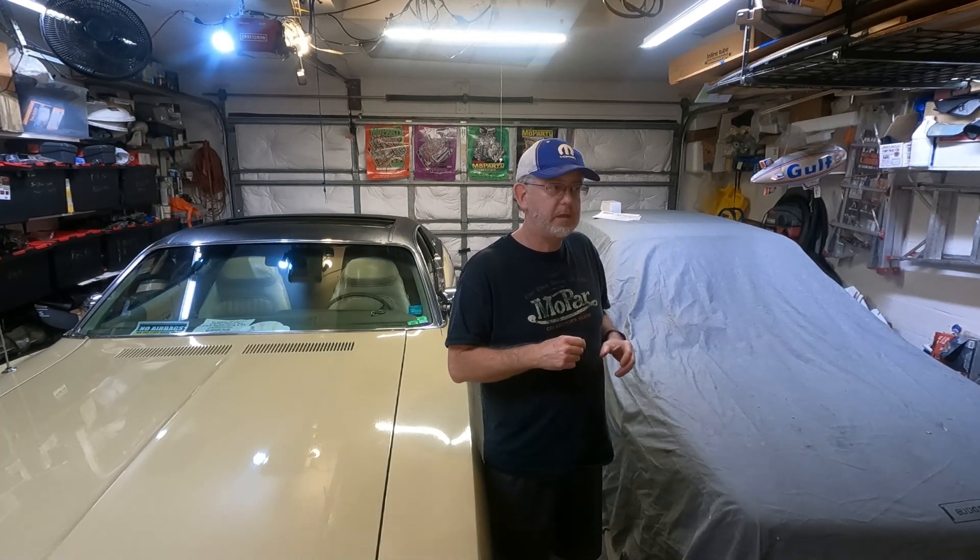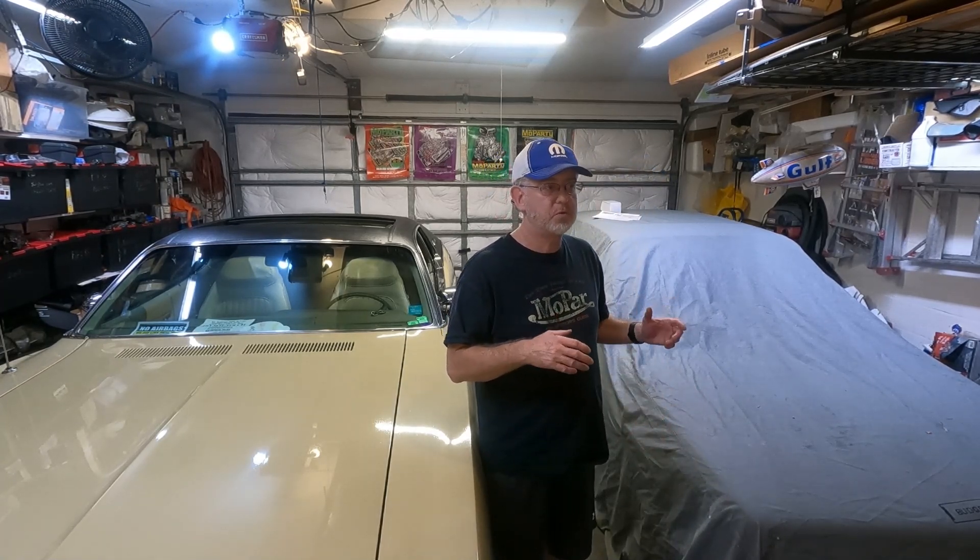So now I've been running non-ethanol in this car from Murphy's. I'm lucky I have that here — they're 93 octane, pretty good gas. Haven't had any issues with filters, so I've been very happy. The cars are much happier because before I did that I had to change the plugs down to cooler temperatures because ethanol burns way hotter. And you have to think about that also — if you have a car that's not completely computer controlled, if it's a dumb computer like this is, you really need to make sure that you're not getting any pre-detonation.